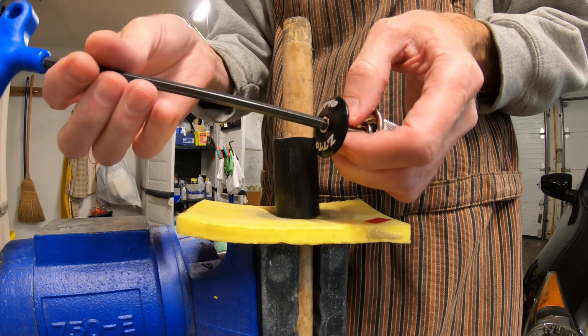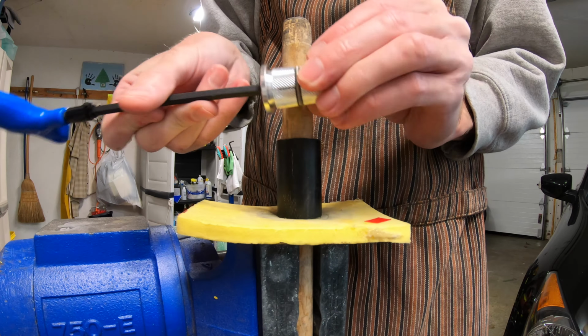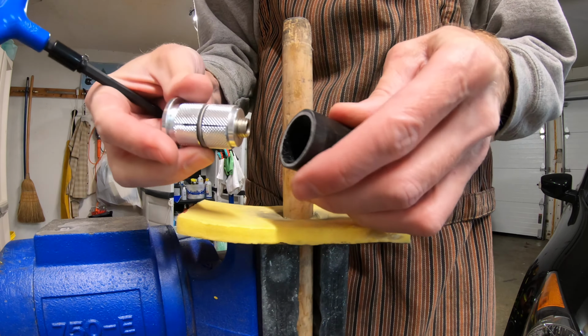You've got enough potential problems without knowing right off the bat that they're liars. These, as you can see, if you're not familiar with them, are simple wedges. Squeeze these together. It pops out, gets bigger, and fills up the inside of your steerer tube, hopefully holding the plug in place as well as preventing you from crushing it by doing what I just did.